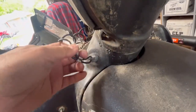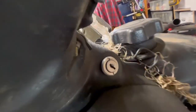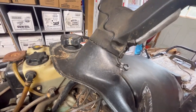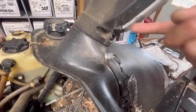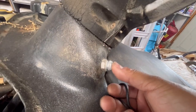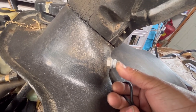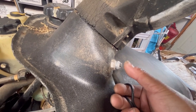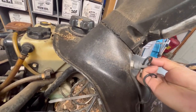This is the tether — I guess if you pull it, it stops the machine. You're supposed to clip this onto your body so that if you get thrown off while riding, the snowmobile won't keep going. When you pull it, this thing comes off — there's a kill switch here. When this switch is pushed down it means the machine will run; the minute you pull it off it's killed. So for testing we want to make sure we keep this engaged.